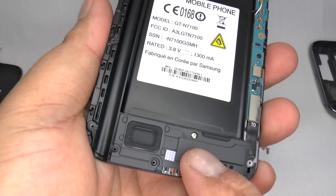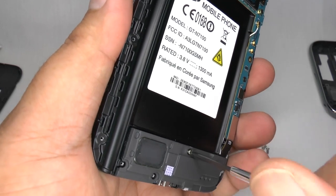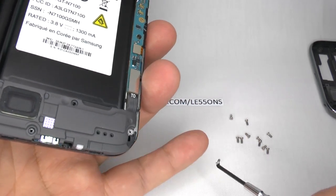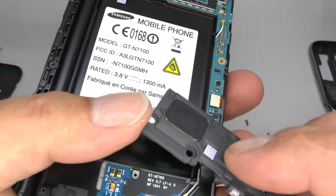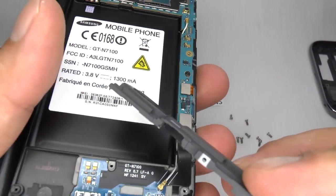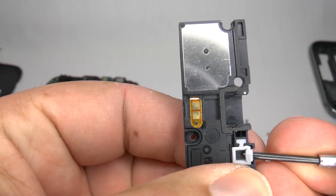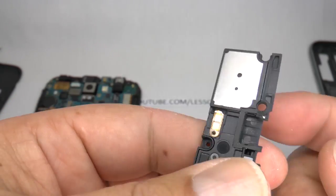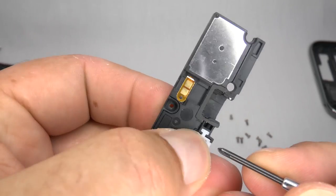To remove your 3G GSM antenna and loudspeaker assembly, we need to undo this single silver screw at the bottom. This is slightly smaller than the case screws, so it's hard to get it mixed up with the others. This speaker assembly also contains a moisture indicator — it changes colour if it gets wet. You've got your loudspeaker and there's a small rubber microphone gasket that you may have to transfer over to your new part if you're replacing the loudspeaker. Just lift that out and then transfer that over to your new loudspeaker. Make sure when you put it back in that it goes all the way in and it sits nice and flat.